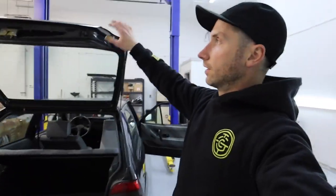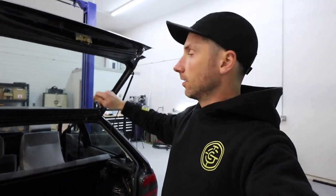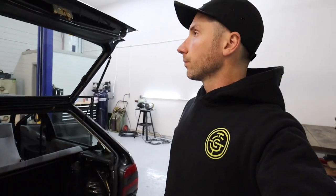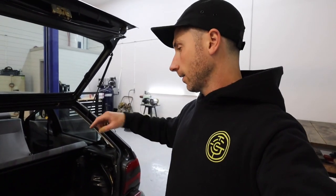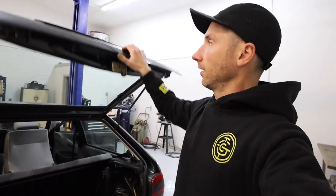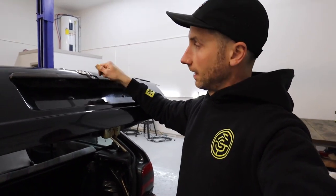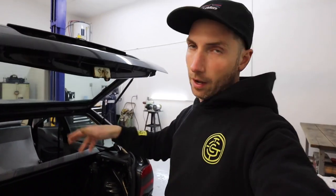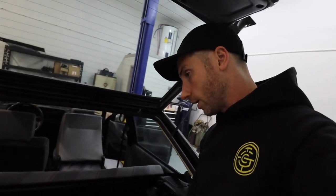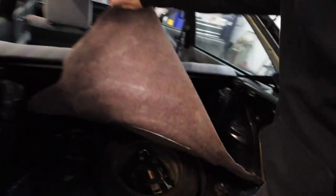The trunk hatch was actually broken. It was locked and neither key would work the tumbler inside to open the latch. I didn't film it, but I got into the back, got the panel off, and was able to get it open. The key does work; I think it just needs a bunch of lubrication. I was able to get it unlocked and can open and close it, because I'm gonna need to get back here. That's sorted out now. Everything's super solid back here. There's no rust, there's no moisture. It's got a full spare and jack and all that still in there.